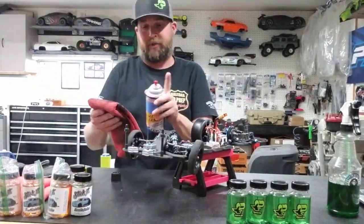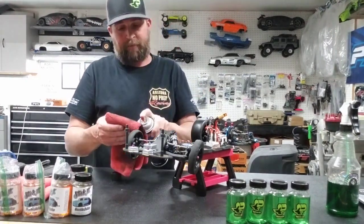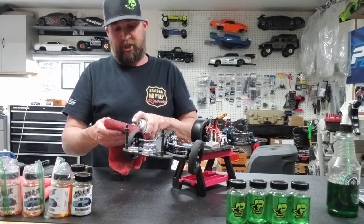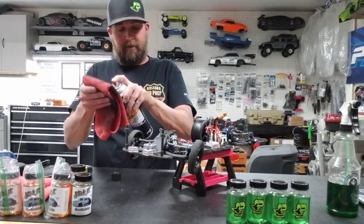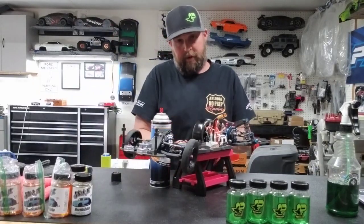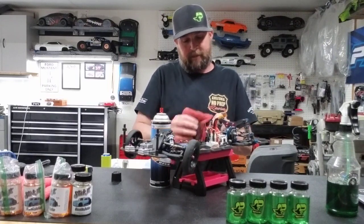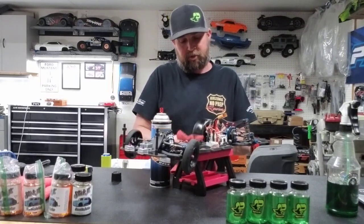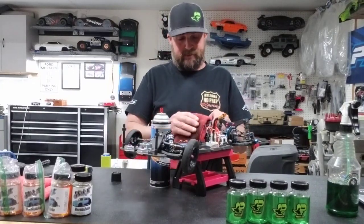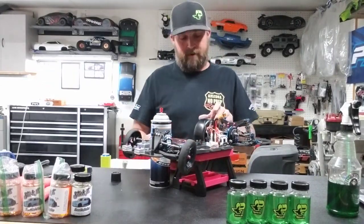And you won't get away with just spraying it one time and then trying to do the whole tire. It's going to take a couple sprays depending also on how well it's stuck to the tire. So I just spray a little bit in there, barely even spray it till it kind of just piddles out. Hold the tire and rub the tire just like so. And you'll notice as you start rubbing, the brake cleaner starts to dry, it's going to start grabbing the microfiber, almost like it's got prep on it, and it's going to start pulling it and sticking to the tire.